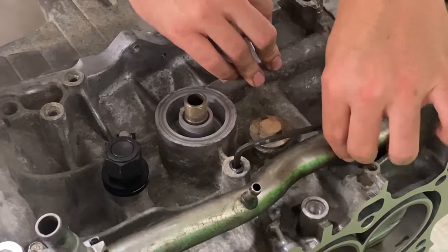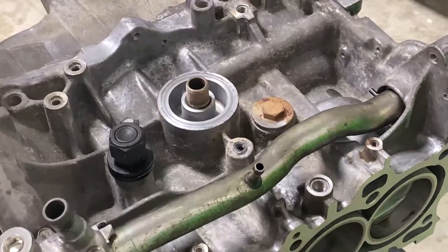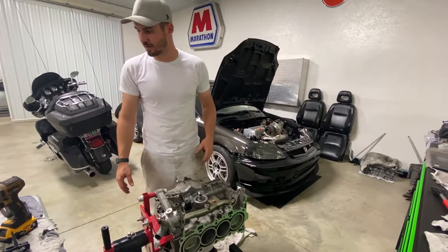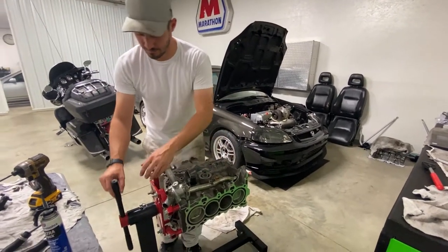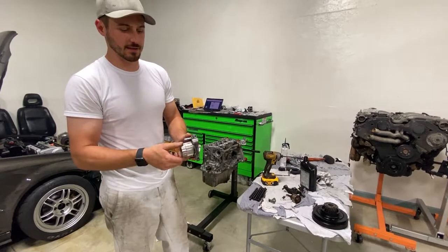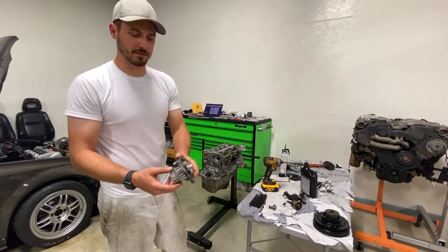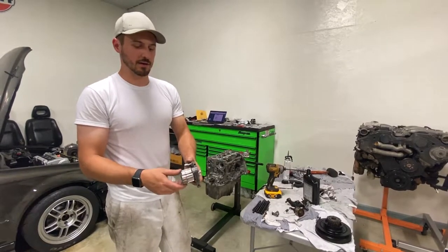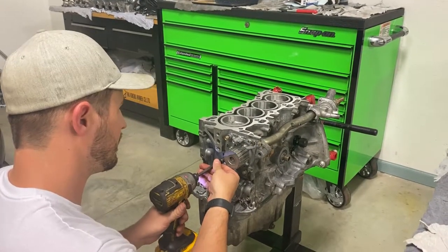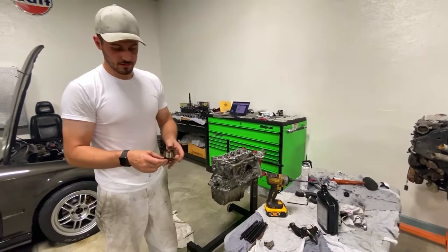Go just a little on the tight side — good to go. Get the excess off. And that is an oil pressure sensor delete — you don't need that. First we'll go ahead and put the water pump, mount, and pulleys on real fast — build the front of the engine. This is a used water pump; we only used it for one race and it still feels really good. If you spin it and feel the seal resist the rotation, it's still in good shape. As long as there wasn't any water coming out of the weep hole, you're good to go. So this pump we're going to go ahead and reuse. This timing tensioner pulley looks awful, but it spins all right.